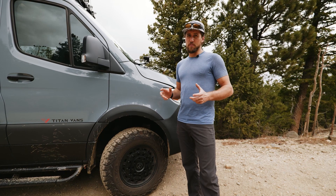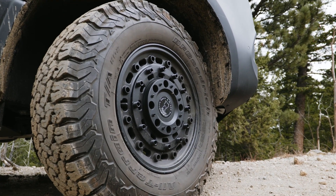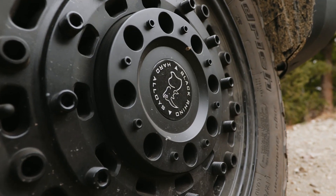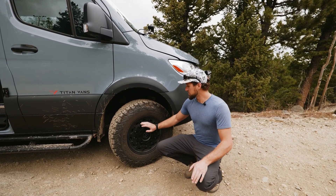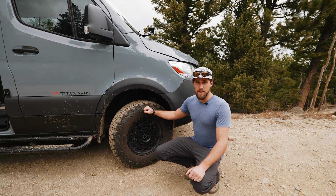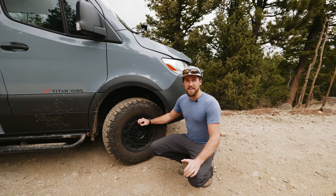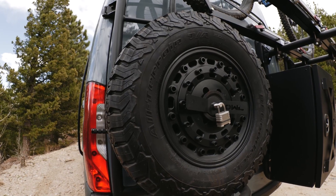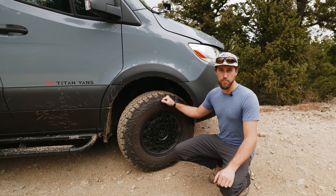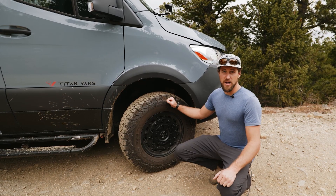You can add all the off-road upgrades you want, but if you don't get the right wheels and tires you're really going to be hurting. These are the BFG TKO2s — a very common and popular tire — and these are the Black Rhino Arsenal wheels. The arsenals are a higher-end alloy so they'll be a bit lighter for better performance, but the rubber is really where you'll see performance tick up. Our wheel and tire upgrade includes all five tires including your spare. We offer the BFG TKO2s or the Cooper Discover AT3s — both E-rated tires, which are the proper tires for the weight of these vans.